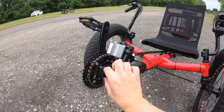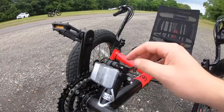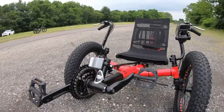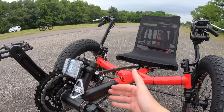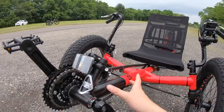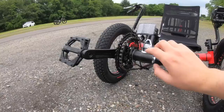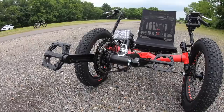On this boom area, this is where you have what is usually called the bottom bracket, but it's up in the front of the bike, along with a little extension to accommodate both the shifter for the front derailleur and a reflector. You can also shorten the boom to fit inside a truck for long-term travel — you undo two bolts and press it in, though depending on the length change you may need to adjust the chain. This bike also has an eight-magnet pedal assist system — a cadence-based system reading crank rotations — as well as a throttle for powering the electric system.